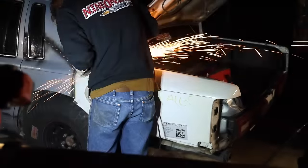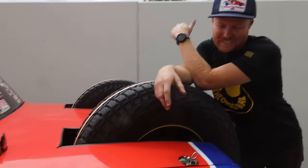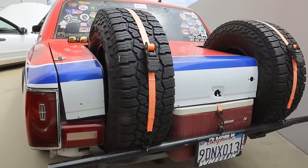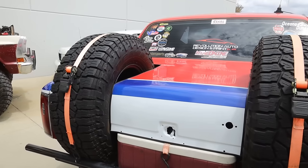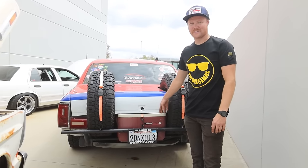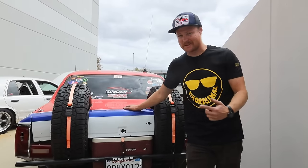When it got rear-ended from back to front, I had essentially a totaled car with no quarter panel — it peeled off like a tin can. There's no body filler in this car, all metal work. I chopped it off and de-skinned a yacht club edition all-white Lincoln Town Car from the junkyard, then cut and re-skinned the entire back half. In one day I de-skinned and re-skinned the whole quarter panel. It now has two Falcon spare tires in the back on a grafted two-bumper setup with a Poly-Lite 34 cooler. Underneath it has an 8.8 rear end with 4.56 gears and an Eaton Detroit Locker.